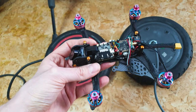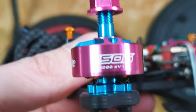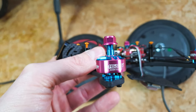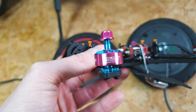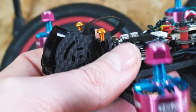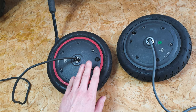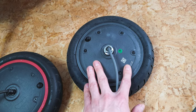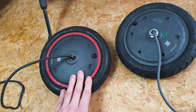Check this latest drone build — on drones we have four motors with numbers like 1506 indicating size, and a KV rating like 3000 KV. KV is the number of revolutions per volt: at 1V the motor spins 3,000 RPM, at 10V it spins 30,000 RPM. The same applies to bigger brushless scooter motors. A lower KV motor means lower top speed — that's why the Pro version goes around 32 km/h while the classic Xiaomi can hit 40 km/h at the same battery voltage. But a lower KV motor is more efficient and more powerful.